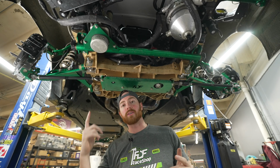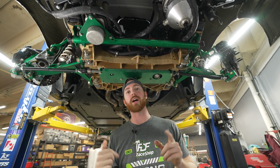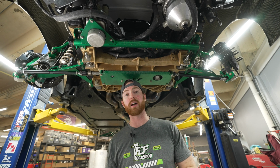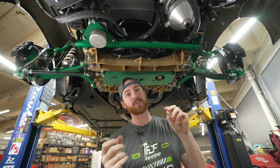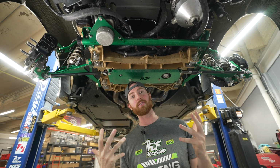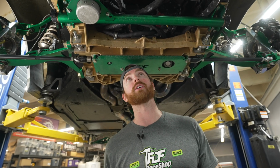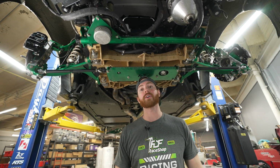Anyone that's running an electric hydraulic pump and puts it in the trunk, you're losing line pressure. Every foot of line, you're dropping 70 to 100 PSI. In order to make up for that, you would have to go to like a dash 10 or 12, but then the pump won't have enough flow. So you'll likely always have a problem if you have an electric pump in the back. Don't do that. It's not good. That is the Corvette rack relocation kit.